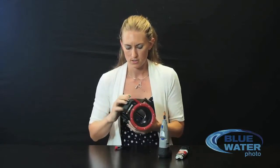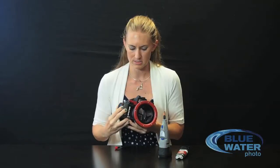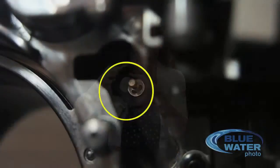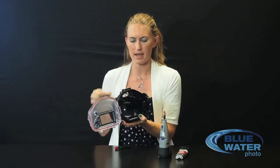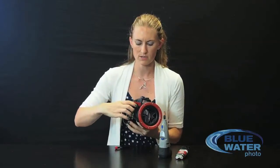Once the port's off, you're going to want to tape over it so that no little plastic dust gets inside the housing. Then you're going to remove the button from this housing. If you look closely, you can see there's a little rod in here. You have to get a pair of tweezers or a pick, pull that C-clip off, pull the button out.